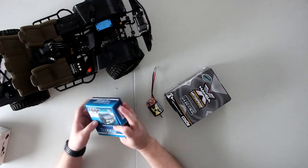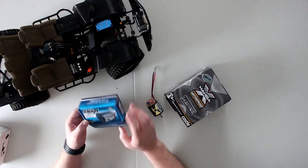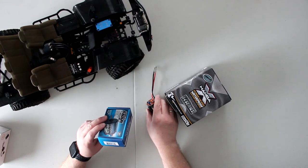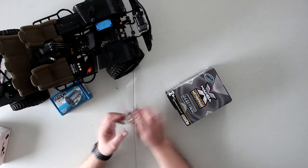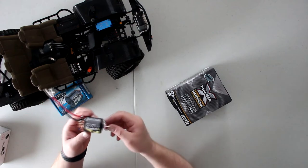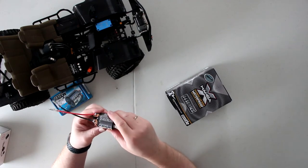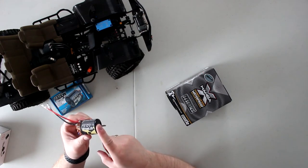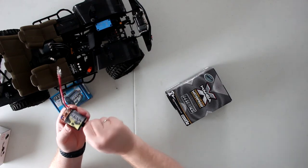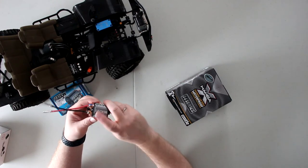I have the Radii motor here — if I remember correctly this is a 12-turn five-slot motor. They say it's roughly about 2700 kV, but not really. This is equivalent to a 35-turn crawler motor. When I turn the motor it's super smooth — you feel a little notchiness, but that's normal for a five-slot. A normal three-slot brush motor feels clunk-clunk-clunk; this five-slot is much smoother for crawling and is timing adjustable.